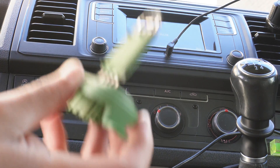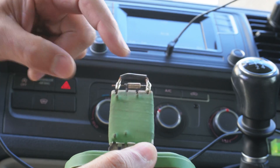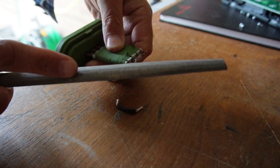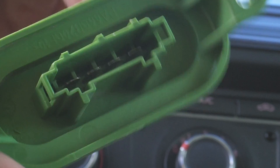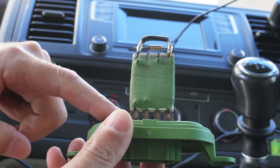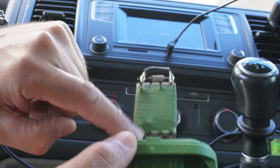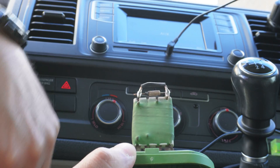What that is, is your resistor pack is blown. This is the fuse at the top and that's a thermal fuse — at some point it's got too hot and blown, and what I've done is bridged it. You can see the four prongs in there corresponding to the four legs, giving you the three settings. The reason it comes on at four is because it's bypassing this anyway. On settings one, two or three, the settings reduce the resistance through this pack to give you the different fan speeds.